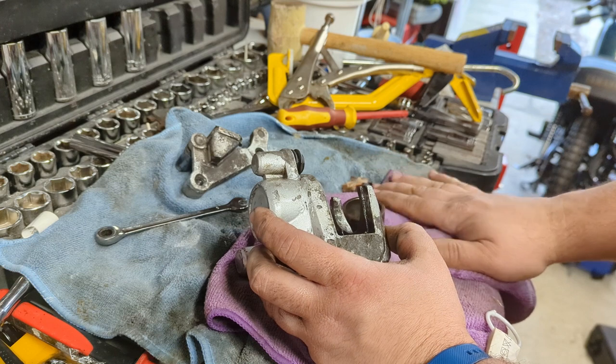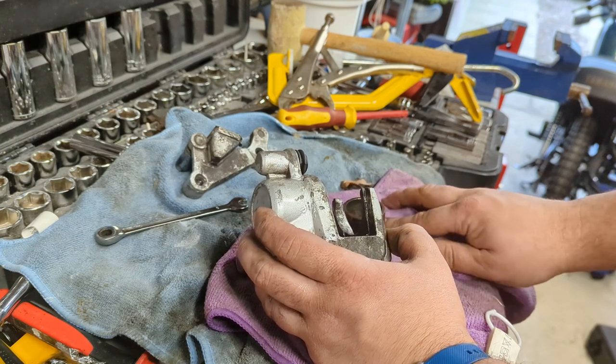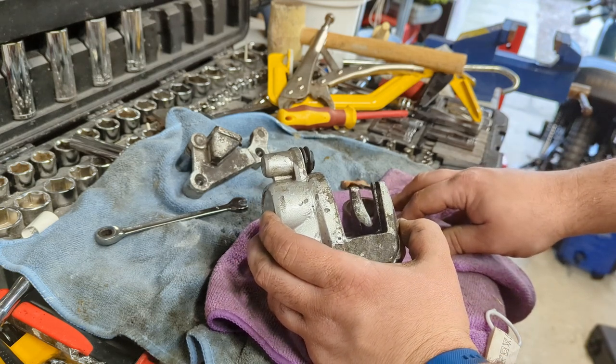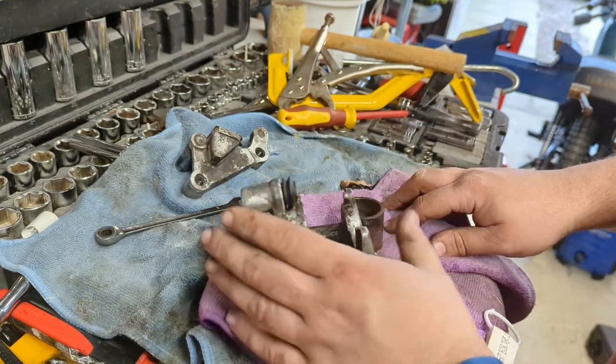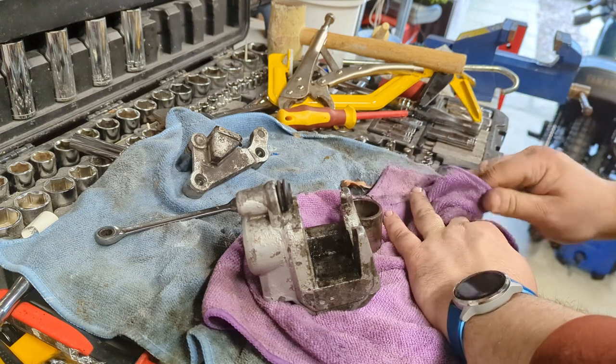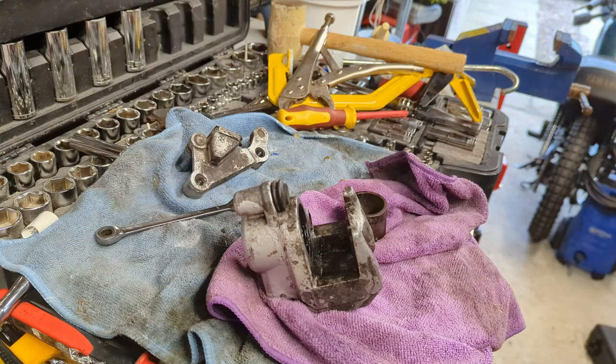I'll price up what it's going to cost to replace the seals versus just the piston and seals, or possibly just buy either a second hand caliper that's working and refurb that, or possibly a new one - I know these things aren't too dear. I'll let you know what I decide. The other thing is the master cylinder - I don't know what state it's in. It appears to have good fluid in it, but the window is all crazed and probably not long for cracking, so I wonder if I can get a decent price on the whole lot and just fit brand new. Because if my other half wants to have a go - it's a 125 and she's got a CBT - I don't really want to let her out on anything with anything other than perfect brakes.